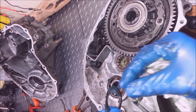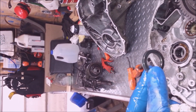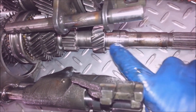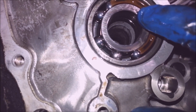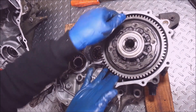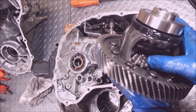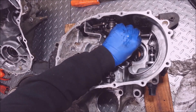I got a tapered washer and a regular washer. I got my stuff over here, just going to put it right back on there where I found it. There's a little bit of scoring on the input shaft where the bearing is, but it's not really worn — I got to this in time, so it's going to be fine. That one looks like hell — that's my noise. I got a bearing kit.